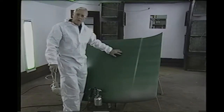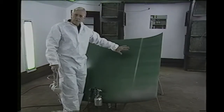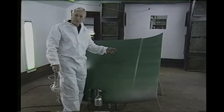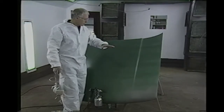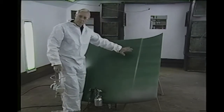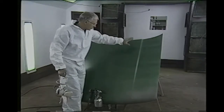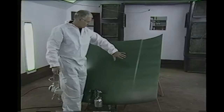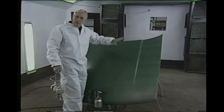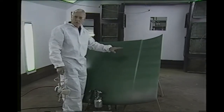Now when you're also doing metallics, it's smart to only put a couple of coats of the color on, and to finish the whole project with a clear. Because if you put your metallics on and you try to buff or polish them, you're going to have haloing and different shades that'll come up because of the metallics. If you come over that with clear, you'll be buffing only on the clear, and you won't have a problem with that halo effect.